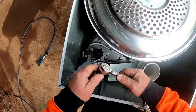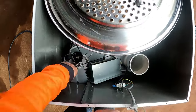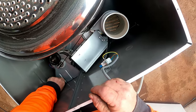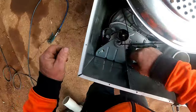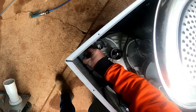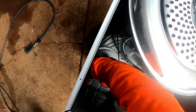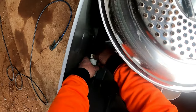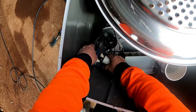Undo our motor capacitor. The motor capacitor is just down in here - it should come with a brand new nut but we'll sit that there just in case. This is your motor capacitor - just take that out. It's only held on by two spade connectors.